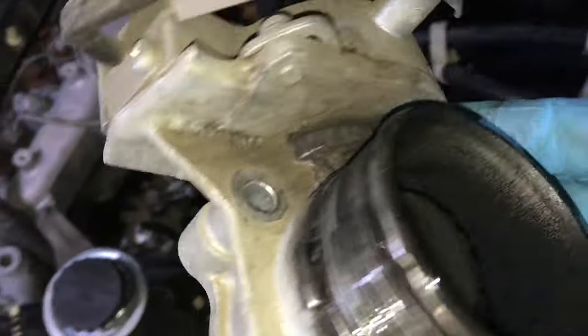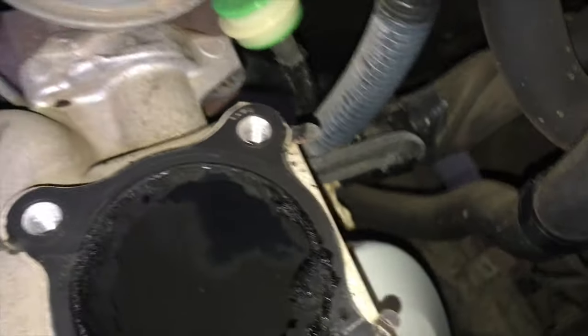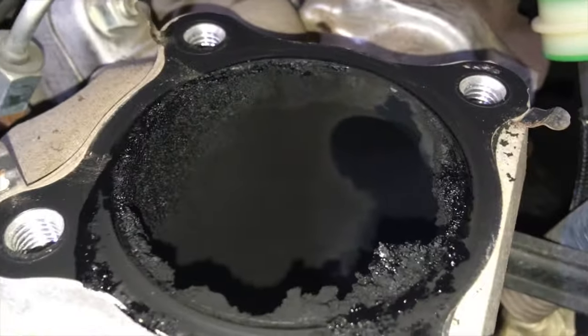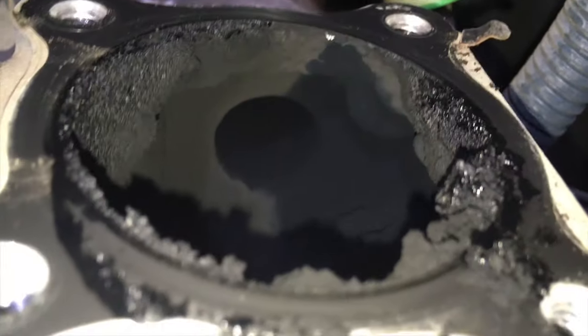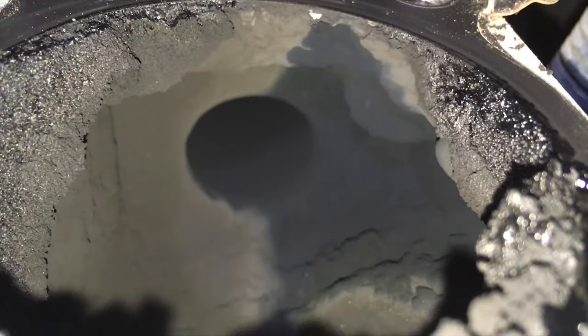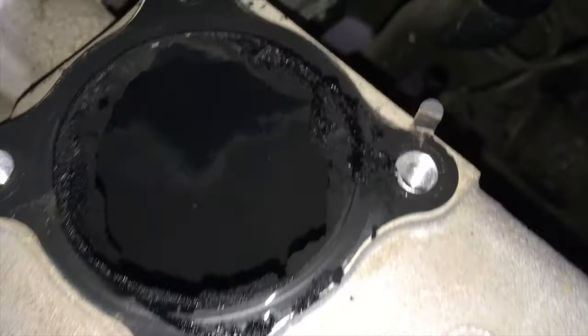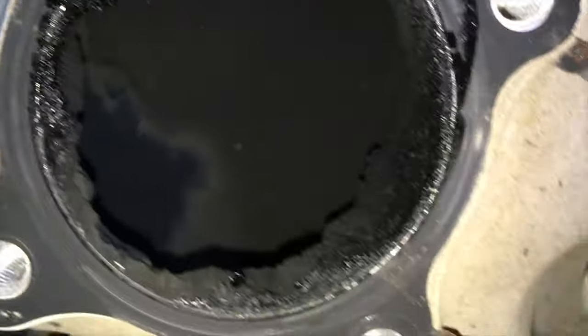Let's have a quick look in the inlet before we move on. It's a bit messy — that's typical of these engines. You can see around the gasket edges where carbon is coming in — that's your EGR valve at the back there, coming in through that hole. Have a good look at that buildup. It looks really bad but it's not the worst I've seen, and on the 1KZ even more so than the 1KD, the worst of it is right here at this opening.